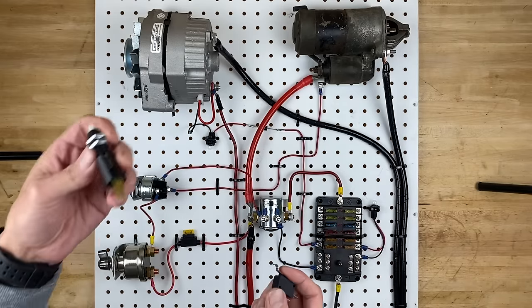Astute viewers may have noticed that the gear on the starter actually stays out for an additional second for some reason. There's a way to fix that — and of course it's a diode. If you put this diode in place of this jumper wire right here you can actually make the starter gear come back in faster because you're not holding voltage in the solenoid any longer. That extra voltage is just kind of hanging out in this cable until the motor stops spinning, but the diode shuts that off immediately so the gear comes back in right away. You can see how much faster the gear comes back in with the diode in place.